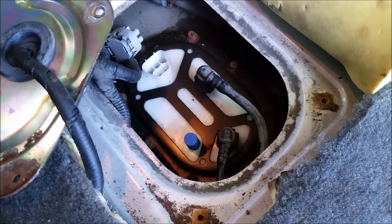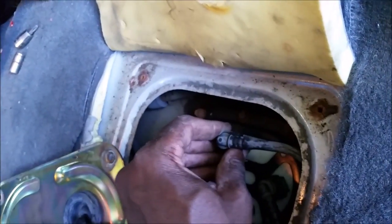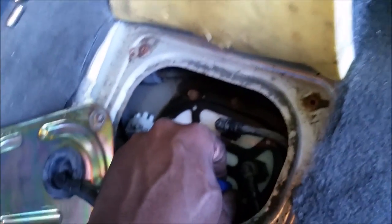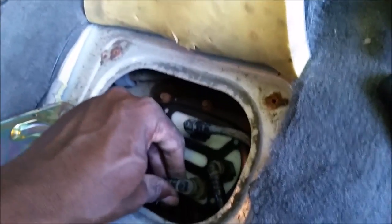They sold me one for a different vehicle. The strainer was longer than the original one. This little piece here isn't supposed to be there for this vehicle, but what I did was replace it with a different strainer and I'm installing the fuel lines on there, and removing those shipping caps. Get the fuel lines installed.